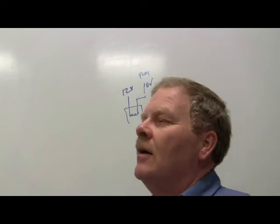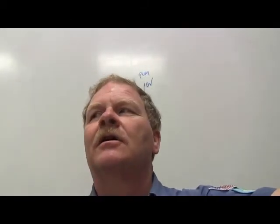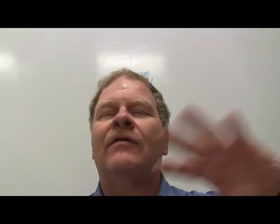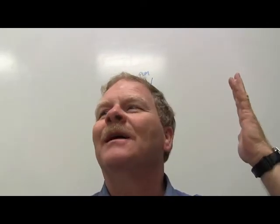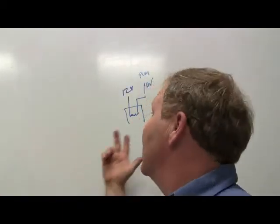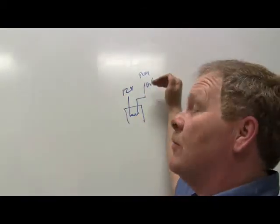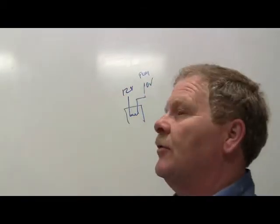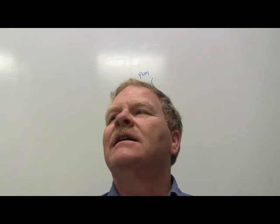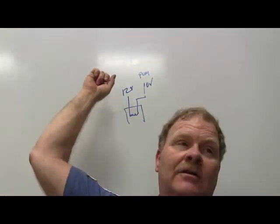The code went away. What triggered us was somebody had already replaced the oxygen sensor, and when that didn't fix it, they gave up. But we actually went deeper and troubleshot it, and it wasn't complicated, it's just 2 wires. When I'm supposed to be grounded, the ground is switched in the PCM, and the 12 volts is supposed to be there all the time. Pay attention to the fuses though, because you may have blown fuses feeding those oxygen sensors too.